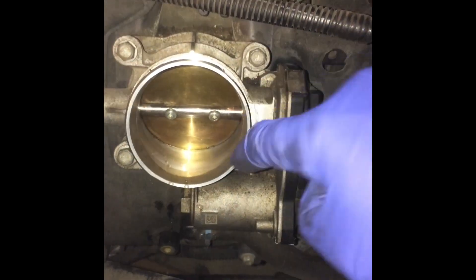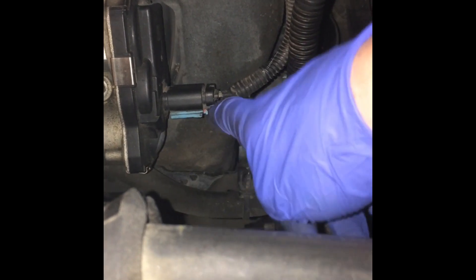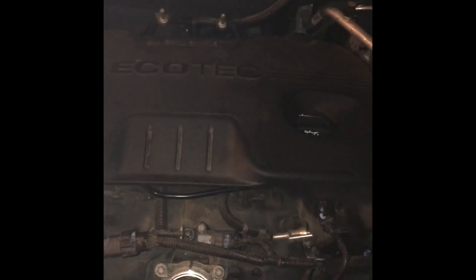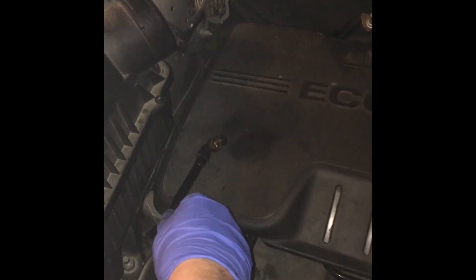Four bolts — don't tighten them very tight. Then slip this on, and slip the little red tab that slips down as soon as it latches there. Go ahead and put the air intake back on — hose here, hose there, two grommets — and make sure that this hose is clipped back in too. If you forget to put that on, it can cause you quite a bit of trouble. Then turn your battery back on and you should be ready to roll.